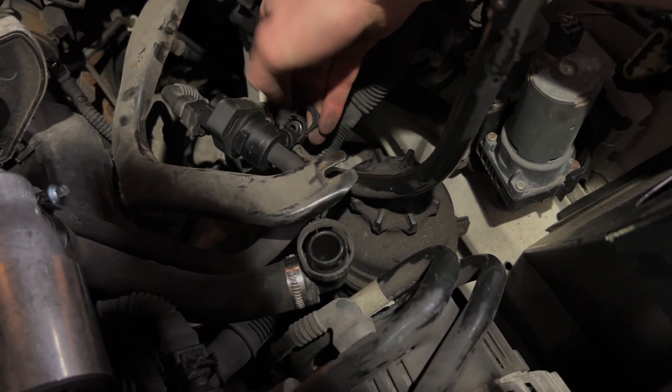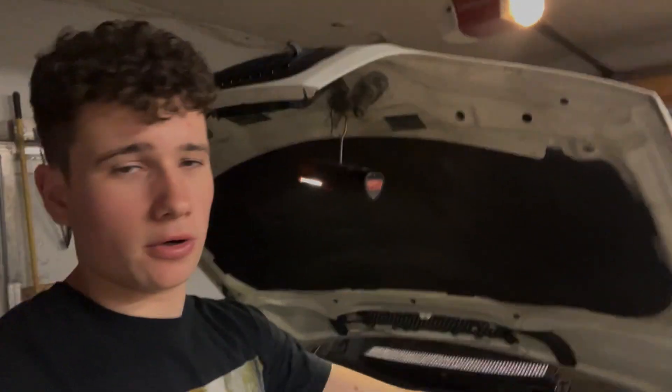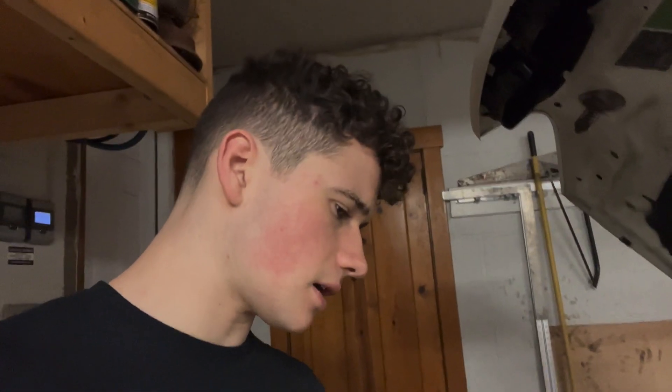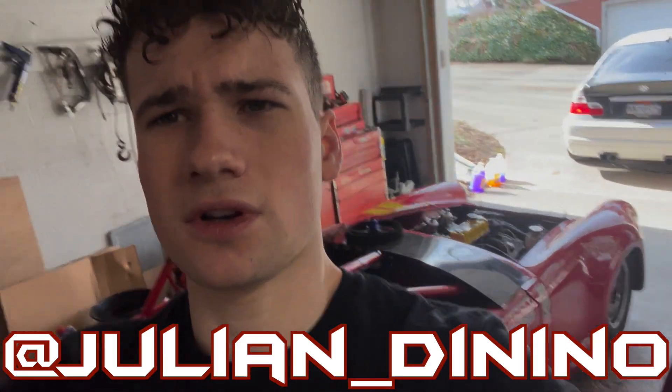This is the line that goes down to the gas tank — clicking that in. That clips to the bottom of the intake plenum. I'm going to slip the intake plenum on and put on the hose clamps off-camera because it takes both hands. I still need to buy a tripod so I can do time lapses. I'll clean inside the intake manifold, put it back on, bolt all the intake stuff on, and then we should be good. Next video will be an Austin Healey video, then probably an E30 video, then I need to work on the E28 — and I'm sure there'll be more M3 videos too.